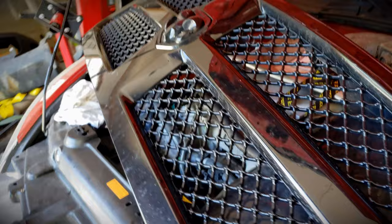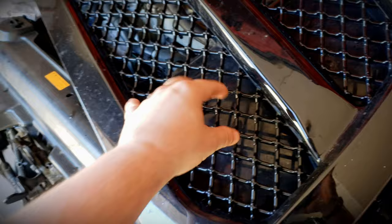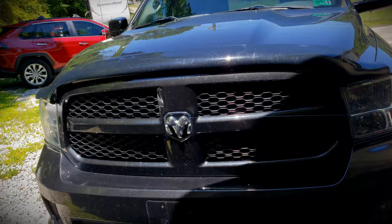My neighbor is cutting grass so there's going to be a lot of musical montages and time lapses. Tools for this job are very simple: you need a clip removal tool and a 10 millimeter socket — that's it for the grill removal. Once we get the grill off, there are some tabs and ducts in the back that direct air into coolers for the eight-speed transmission. It's like a flapper system. I just kind of discovered that — I'll walk you through getting this grill off.